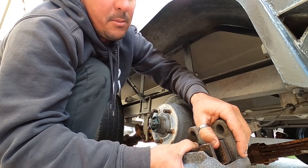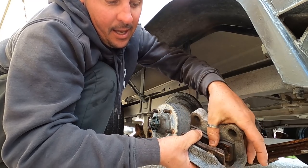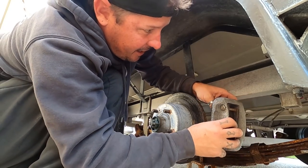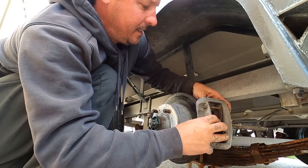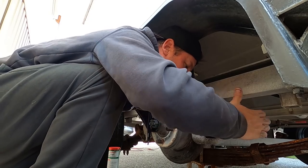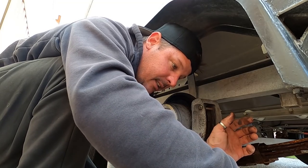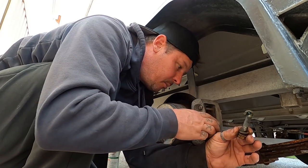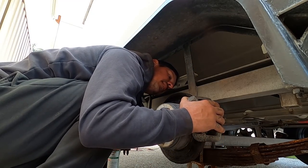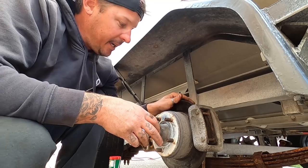This shouldn't be too bad. There's some mechanical brakes on this. So there's your two brake pads. You want to make sure that they are apart. Then go over your caliper, your two brakes, line back up where your bolts were, alrighty, then line up your other bolt, but always put a bit of grease back on your bolts before you put them back in. Boat trailers and salt are just never ending. So that one goes in here. All right, caliper's on, the bushes are back in.